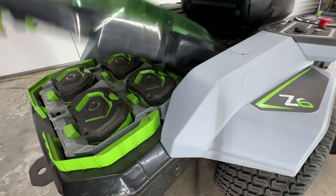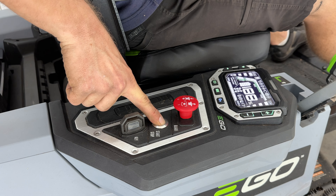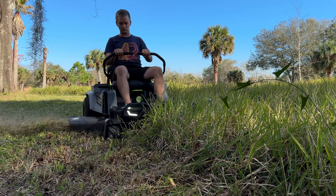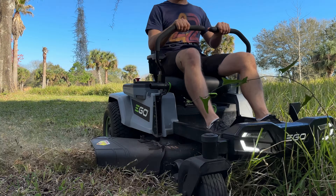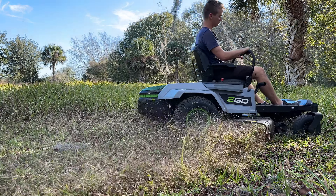Grab your new blade — a little messy but sharp. Put your cover plate back on; this side faces grass. Make sure you line up those two holes. It helps to also put a screwdriver here if you're not using an impact.